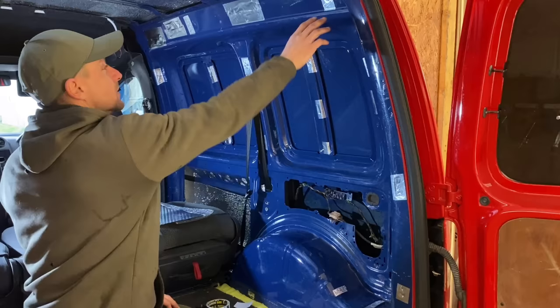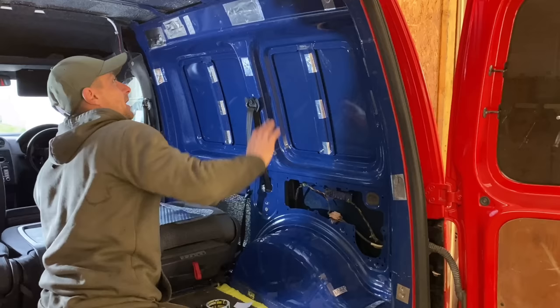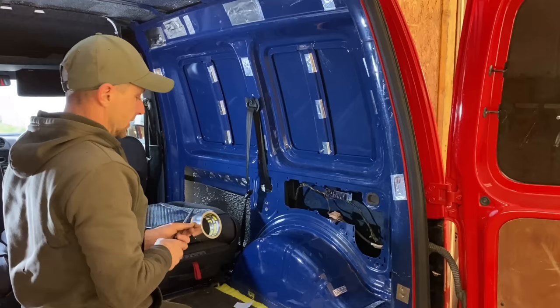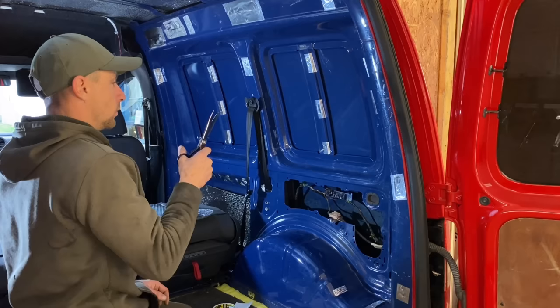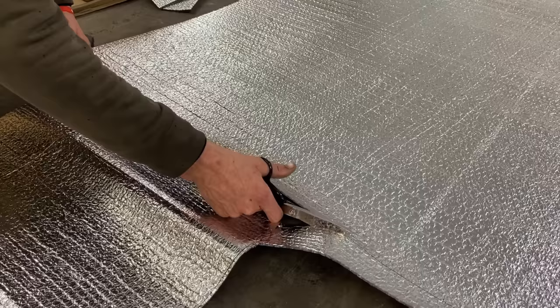Twenty minutes later — all the holes are covered. I tapped down the protrusions, then with the foil tape I've pulled it tight and pushed it in, stuck it on the ends, pulled it tight without pressing it in — that acts as a bit of a straightener. We want a nice flat panel to stick the next bit on. One tip: when doing stuff like this it pays to have a good pair of scissors — I got these off eBay, SuperCut, about eight or nine quid. A nice straight cut makes the job a lot prettier.